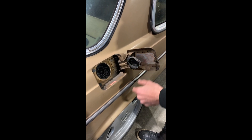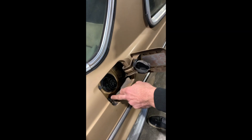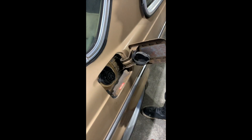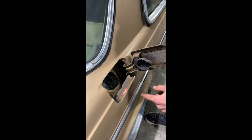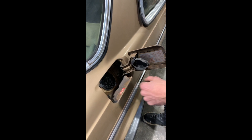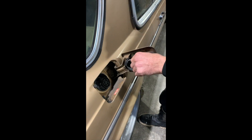Don't pour diesel in there anymore. This piece had another feature: if you overfilled and spilled diesel, this port right here went to a vent tube that went under the car, so fancy people with Mercedes didn't get their hands messy and all the diesel would drain out. But now we took that out to make room for the batteries, so I put a plug in there so that way if something would spill it wouldn't go directly into the trunk onto the batteries.